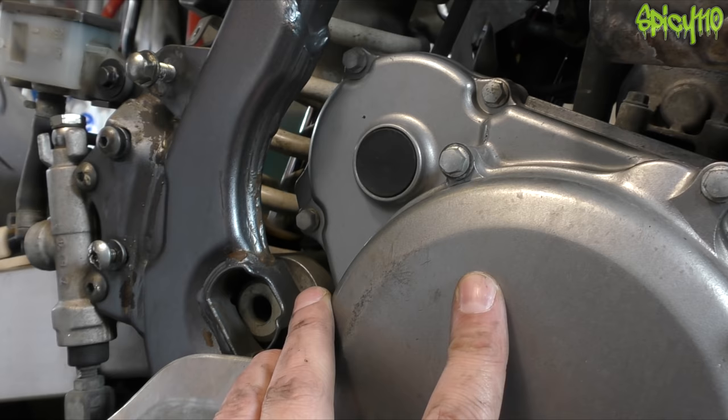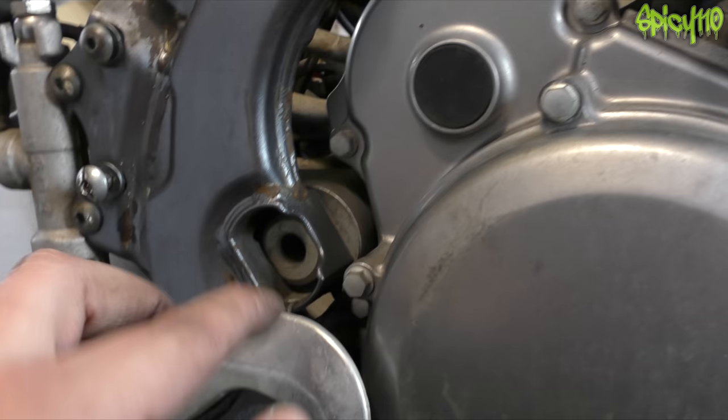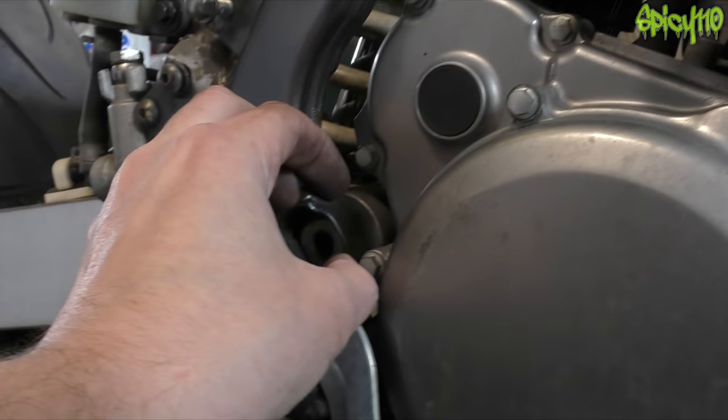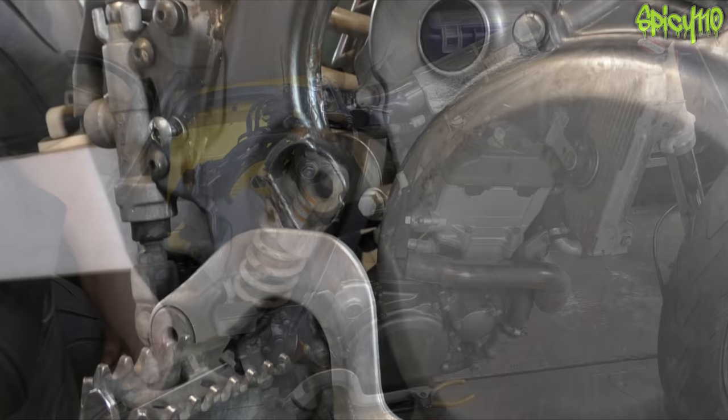I sillily thought, oh well maybe I'll just drop the engine, leave it as a rolling frame and do it that way. But no - the shaft that does the swing arm pivot, the axle for it, that also goes through the back of the engine which connects the frame, this, and everything all into once through this central point. So this pin has to come out and then this will all fall apart basically. Before I take the electrics out I nearly forgot - I need to take some pictures just for reference to make my life easier.